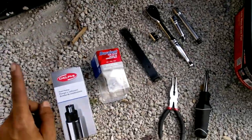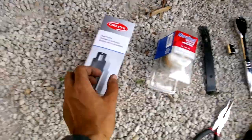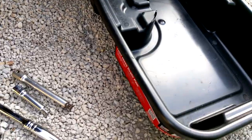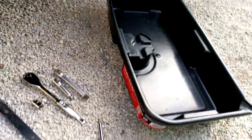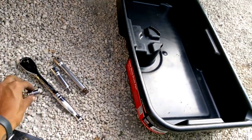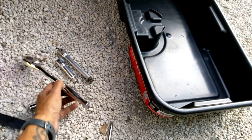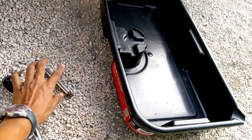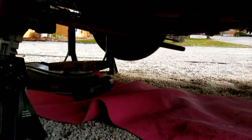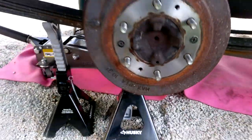All the tools you will need: of course the fuel pump, a new one — I got that from Autozone — and then an assortment of tools: a little catch pan for any spilling fuel, a pair of pliers, a screwdriver, a size 12 socket to go with the socket wrench and two extensions, as well as a jack and a piece of wood to hold the tank as it's coming down, and some jack stands.